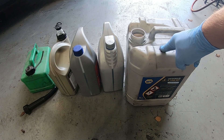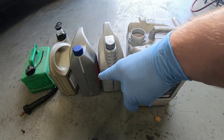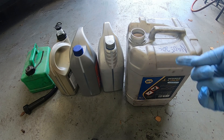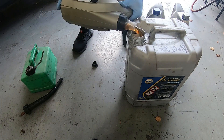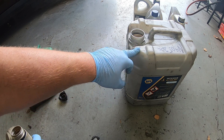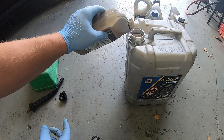Right, this is very simple. We've got an old 20-litre coolant bottle that's all been cleaned out. We've got four and a half litres, four and a half litres, and four and a half litres of mixed clean engine oil. Then we'll measure out a 10% mix of petrol and put that in there. Blend it all up with a homemade paint stirrer — because that hole is too small for a normal paint stirrer. So we've got just under 15 litres of clean engine oil, so a 10% mix will be one and a half litres. This is a litre bottle, so one and a half bottles of petrol in there.